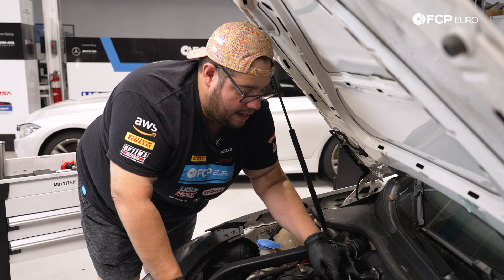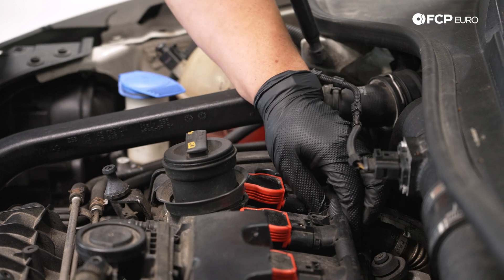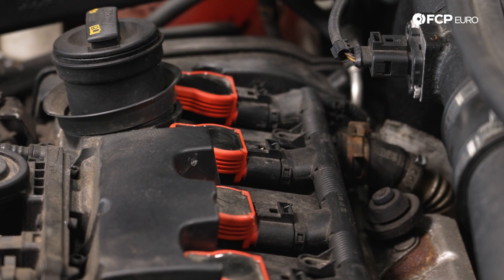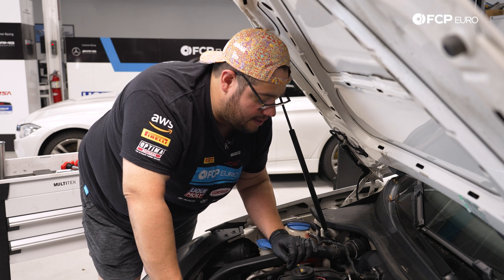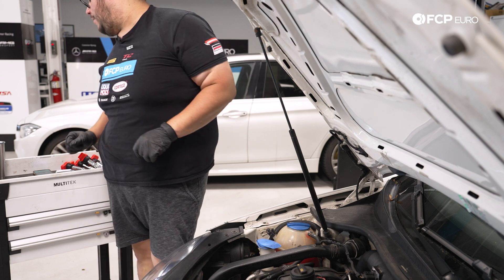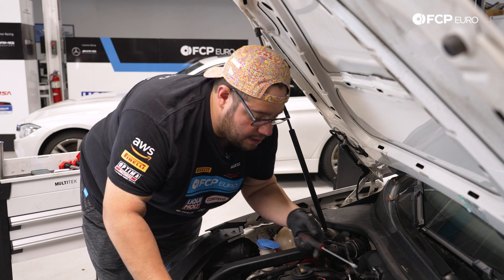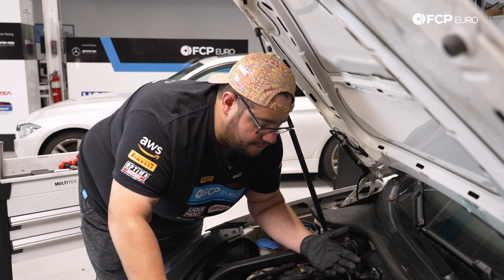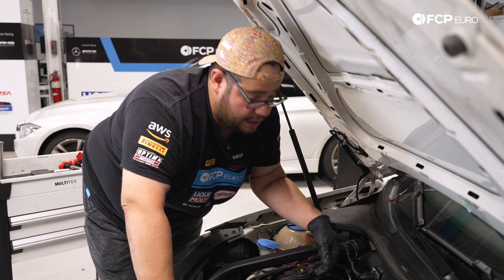To be quite fair, I have yet to see a two-liter turbo equipped with the hardware that holds down these harnesses. I believe they're T20s from the factory, so if your car still has that, go ahead and pull those off now. And if I miss the size, please drop me a comment below. Moving forward, we're gonna go ahead and work on popping up the coils a hair. Because we are replacing these ignition coils, we're not gonna be super gentle with them, but we're not trying to be destructive either. We'll use a small flathead screwdriver to get them up. Another alternative, if you're just doing plugs, you can grab a zip tie and loop it around the back half of the coil to pull it up.